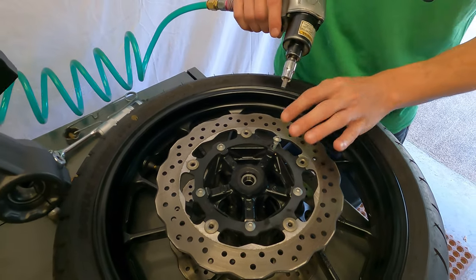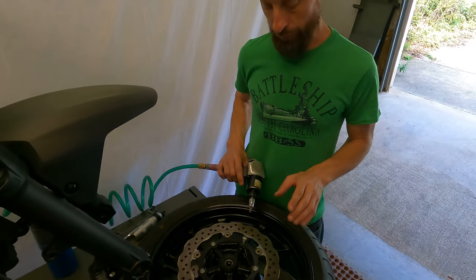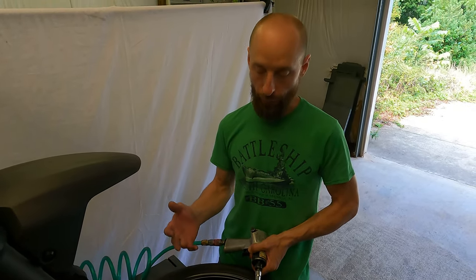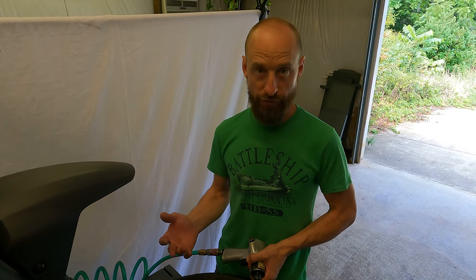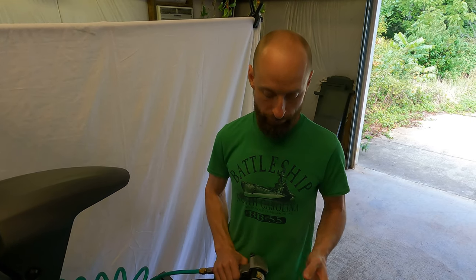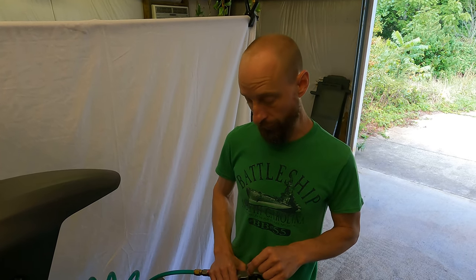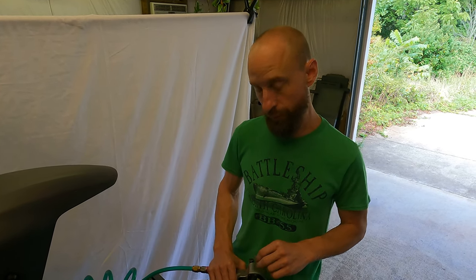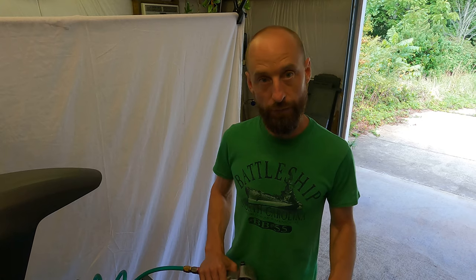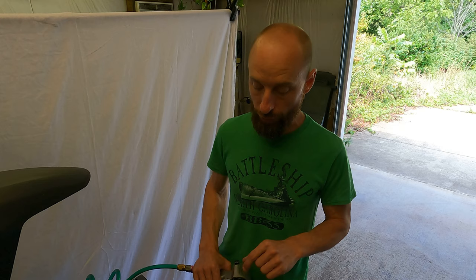We'll give it a quick go — and it comes right out. Remember it's hot after you just heated it. If we tried that on one of the other bolts with no heat and a regular wrench, it's going to go off-center a little and round off. So make sure you're aware of what's around you when using heat and flames to be safe. Apply the heat to the fastener, make sure your socket is firmly and squarely engaged, then put the power to it and they should come right out.